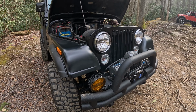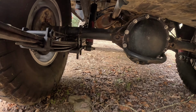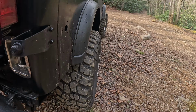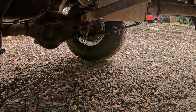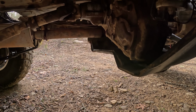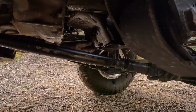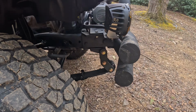All right, Donnie, so going to the suspension, what are we running on this? So on this one, it's all BDS except for the shocks. It's about 3.5 inches of lift total. The shocks are the new Rancho RS7s. The factory front shackle, no reversal on it? It's no reverse, but I'm running boomerang shackles front and rear. What about on your actual axles, the AMC 20 and the Dana 30? You running any special shafts in there? I run the 10 factory shafts.